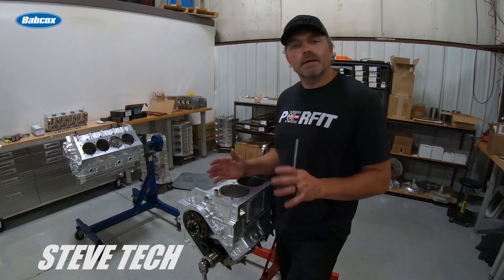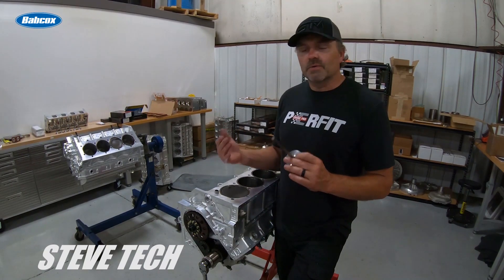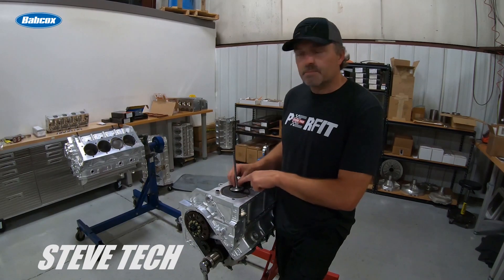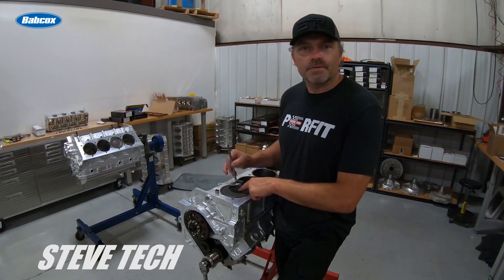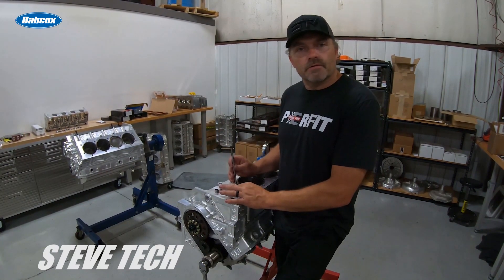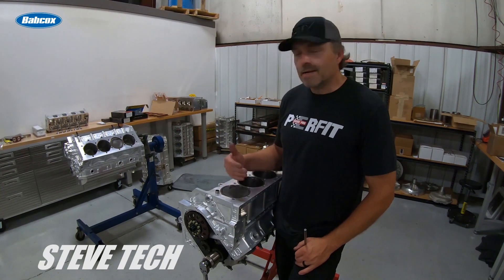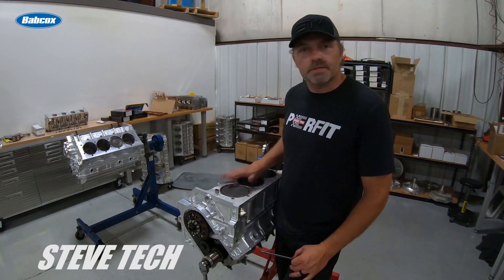Back when I did NX Pro Stock stuff, I learned something interesting. I'm giving round numbers to make it easier, but I remember the actual valve-to-piston clearance because we spent a lot of time making it perfect. We were always shooting for 35 thousandths cold — rolling over with lash set, we would check that valve-to-piston clearance, spinning over by hand, and make sure it was 35 thousandths. In that particular motor at NHRA Pro Stock at the time, the piston was 50 thousandths in the hole, just like this SMX motor.